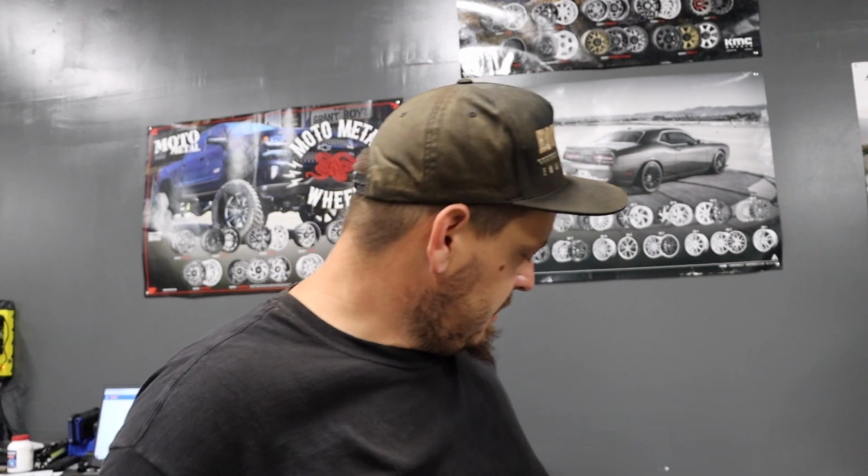I'm thinking about getting a 6.0 and getting it built, and putting this in the truck with a cam and a nice little tune, maybe a small shot of nitrous with the 408. Just get everything in the truck buttoned up, running, driving, and have the 6.0 built for boost. That way I can save up some money and buy a legit turbo kit instead of trying to slap one together.